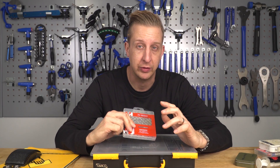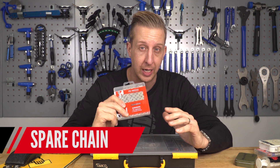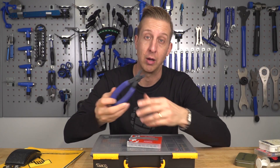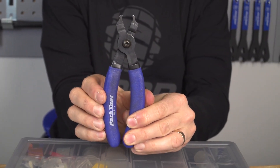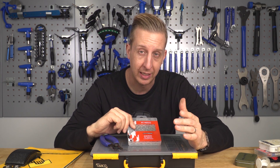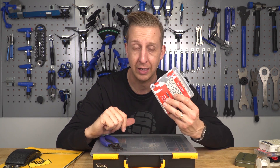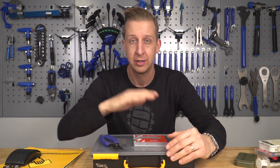Personally I don't like to keep a chain too long — I've had the habit of snapping chains in the past and even managed to injure myself doing it. So I always try to keep a spare chain or two on the shelf ready for when they start wearing out. If you're going to have a spare chain, I recommend a pair of chain pliers — they make it so fast and easy to take quick links out and rejoin them. It's just an invaluable setup to have at home.